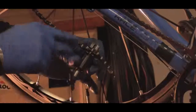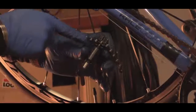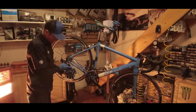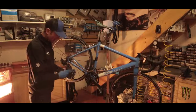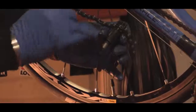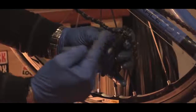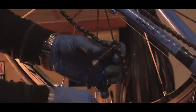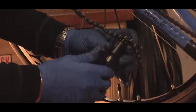It's worth noticing here that there are two slots on the chain tool, on this particular model anyway. The slot at the front of the chain tool is designed for pushing the pin out. The slot further back is designed to spread the links — if you get a tight link in the chain, it will just open the links up very slightly. It won't push the pin through and out the other side. So since we do want to push the pin through, we're going to use the slot at the front of the chain tool.